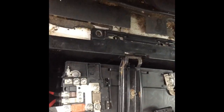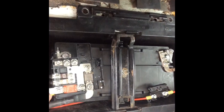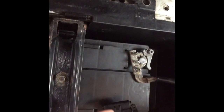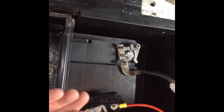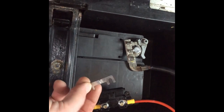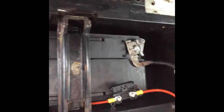First of all, you need to connect to the battery and you need an inline fuse, which should come with the kit if you buy it as a kit. Here's the battery under the floor in the front of the van. We've put the cable that runs to the fuse holder onto the positive terminal — it's got a ring connector on there. This is the 40-amp fuse that goes in there; you just loosen off those nuts, slide that in, and tighten them back up. We've run the cable under the floor and then it runs up the side of the van into the back.